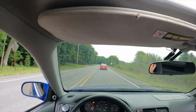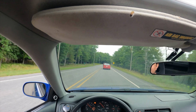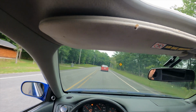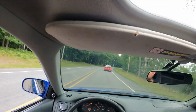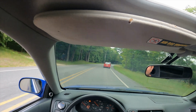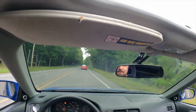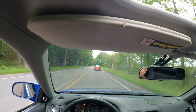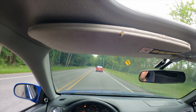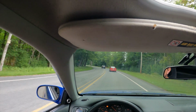Kind of driving like crap, I put an idle air control rotate plate in because the connection was really close to my radiator, and I'm assuming I did something incorrect because it doesn't idle very well. It's really low, and if I unplug the idle air control valve, nothing changes. So I must have that on there incorrectly to the point where it's like blocking off one of the ports. I'll have to dissect it when I have some time.